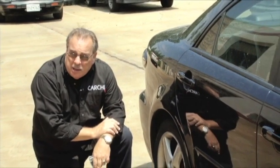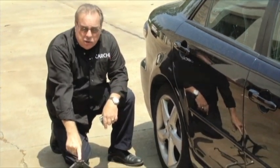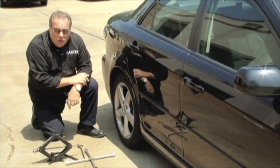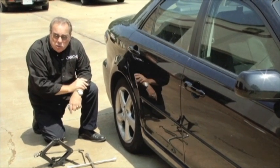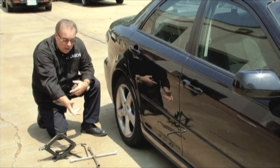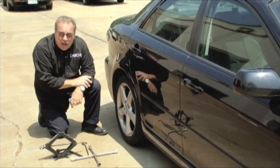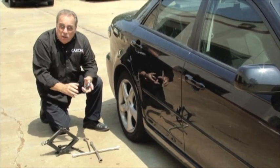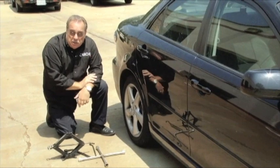You're stranded out beside the road, you've got a flat tire. What do you do? A lot of people think it's a great idea to haul out the jack that comes with the car and change the tire. I have to warn you that this can be a very dangerous operation. The jacks that come with cars are primarily designed for work on hard surfaces such as this concrete. Put this little teeny base on some dirt and you have a very wobbly situation.